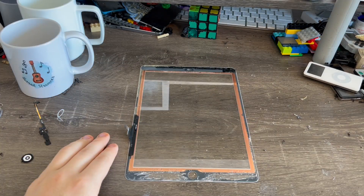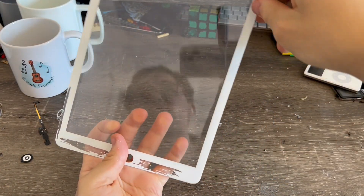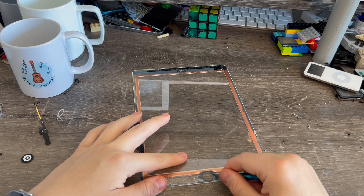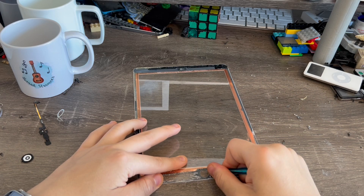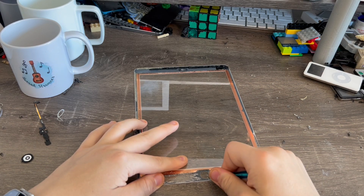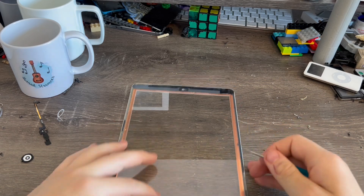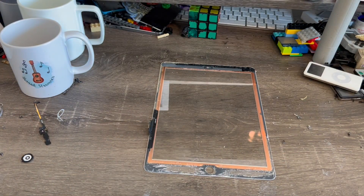After scraping away the vinyl for a few minutes, it's not easy but it looks pretty cool so far. I'm scraping away all the adhesive going all the way around, except for the screen cable area just to be safe. The area along the home button is the hardest part — you've got to be very gentle. For the home button it only scrapes properly in one direction. Make sure your screwdriver is tilted at an angle and you're going very gently. And there we go — I scraped away the home button vinyl.